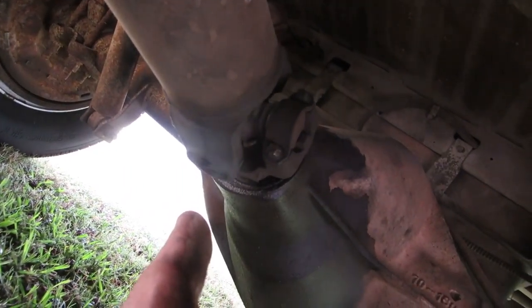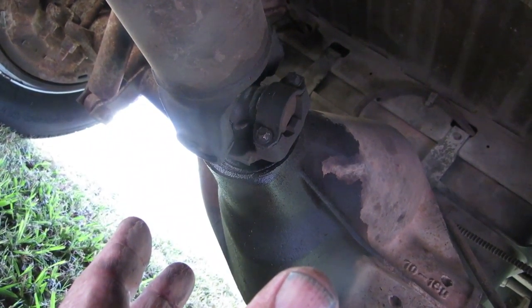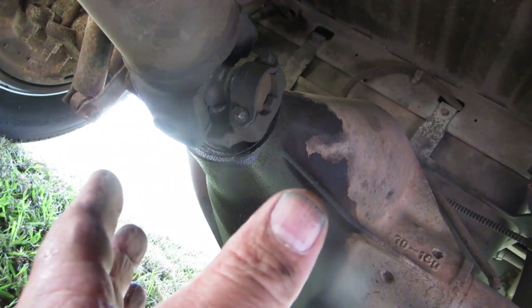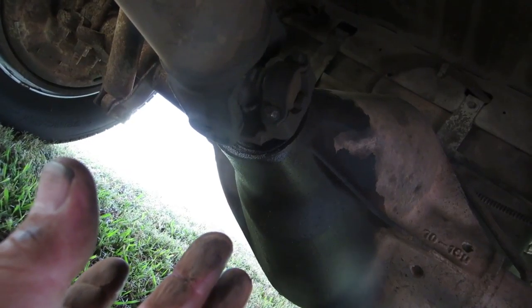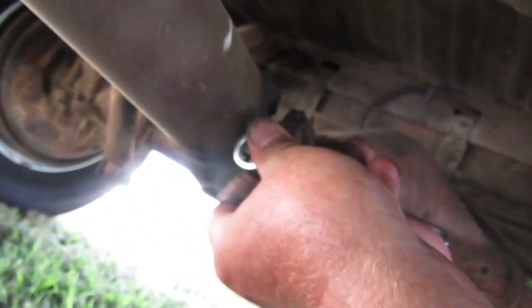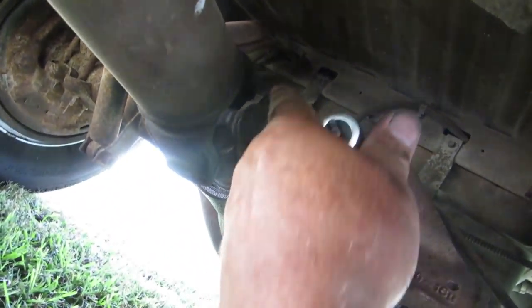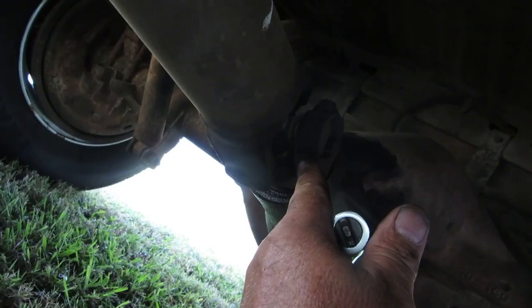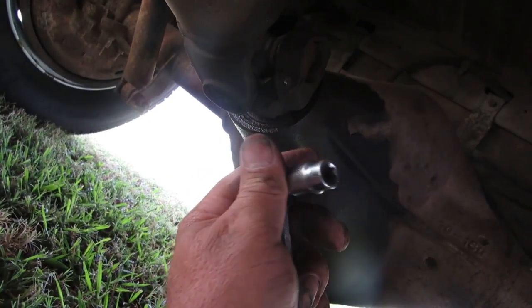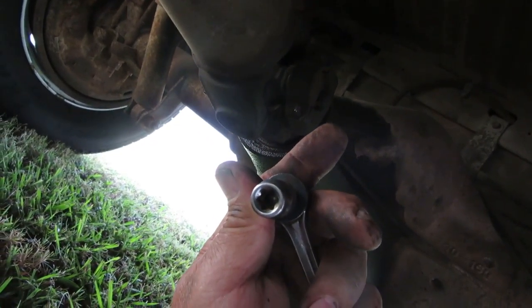My pinion is wet. The deal with the pinion seal is that in order to replace it, you have to take the yoke off, and when you put it together like that it sets the ring and pinion lash, so I don't want to monkey with it right now. I took the drive shaft out and it has these star bolts — you can't tighten them up like you'd want to. They should be cap screws with an Allen, but they're a goofy star thing. That's another winner from General Motors — pennywise and dollar foolish.